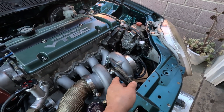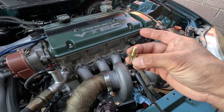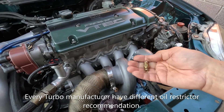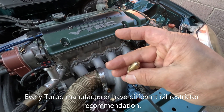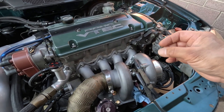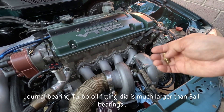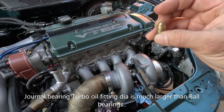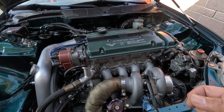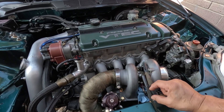I already routed my 4AN lines going to the back of the block. A little bit of information on what size oil restrictor and fittings you must use — this is made by PSR and it came with this. Ever since I've been using this, it's a dual ceramic ball bearings setup and it doesn't really require a whole lot of oil going into the system. It's not like the journal bearing where you don't need a restrictor — you can go straight in. One of the leading turbo manufacturers is suggesting 40 to 45 PSI oil pressure going into the system.